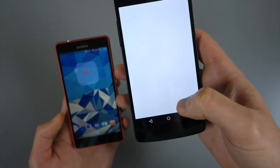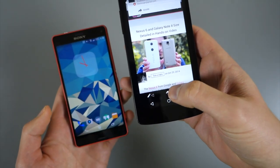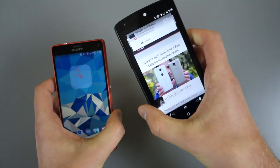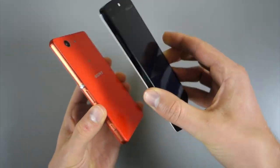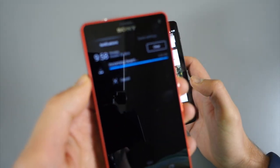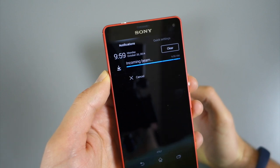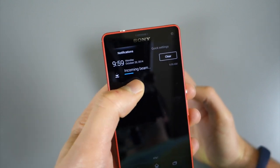So let me show you how it works. If we jump into Google Plus Photos, I've got a photo up here, so I've got my share button and tap that. You'll see now there is an option for Android Beam. So if I tap that, it should initiate a Beam — and there it does a little zoom. It says just tap your device to another device as long as NFC is going. And we'll go to this device — you can see right up top there, incoming Beam. So it's a photo. Beam is still not the quickest thing on earth to send and receive, but it does work. I'm just going to cancel that.